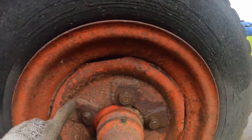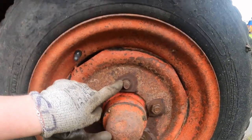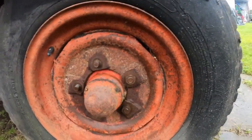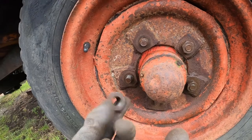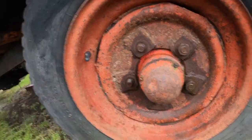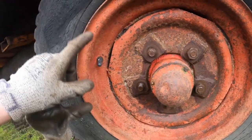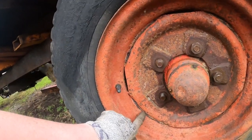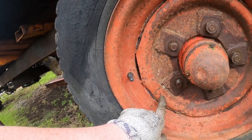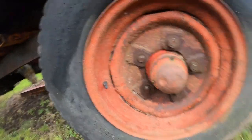This is what I was saying — these aren't really reinforcing things. You'll see on the other side how well these fit to the bolt holes. What somebody's done is, when I first got these nuts they were just normal nuts with a flat face on. Somebody's bolted that on and welded that plate in to give the wheel another lease of life. But this wheel — the valve is on this side. You can see the corrosion sitting in there, and behind here is where the rivets are. On the other wheel, the valve is on the side where you can see the rivets.